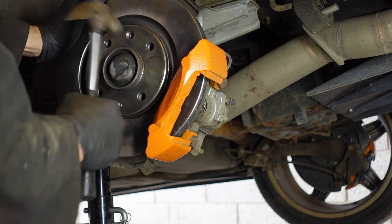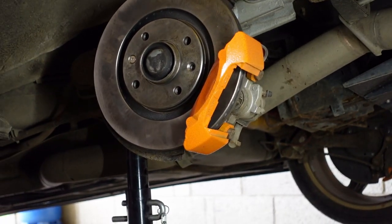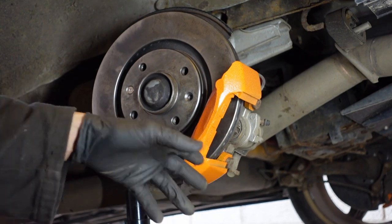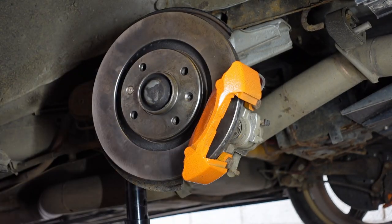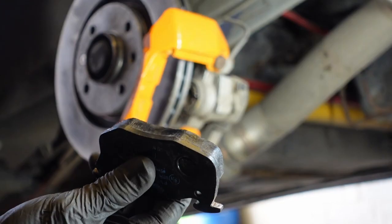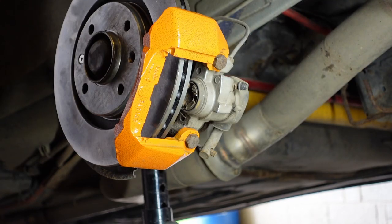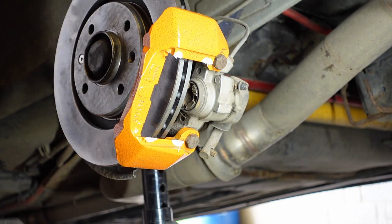Slight adjustment with the Tonya Harding might be required. So it's already looking much cooler, because big is better. All we've got to do is just fit the pads. I do have a rear brake fitting pad guide. Just put the pads in — here we go, a set of pads. Nice and thick. These are EBC pads. The other kit I'm supplying them with has some EBC Greenstuff or something. They're slightly thicker pads, which means they will also last a lot longer. New pads on the original rear brake are like half the thickness. So just put a little dab of copper grease in some suitable locations — on the ears of the pads and on the backs of the pads, where the caliper carrier will be rubbing.